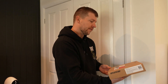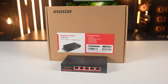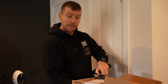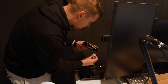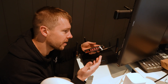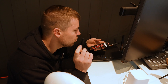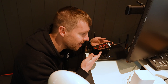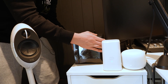So this is our switch — the ASW205T. It's a five-port switch that my friend gave me, so that should do the job for now. Depending on what you guys say in the comments, we may upgrade to 10 gigabit or even 5 gigabit, because we have the motherboards to do it on all of our editing PCs. With the switch, I'm just going to plug in one of my cables. Now that we've got this plugged in, we get our main components — Amelia's PC, my PC, and the two NASes in here as well. They should get 2.5 gig LAN. Security cameras and other devices can stay on the one gigabit network.